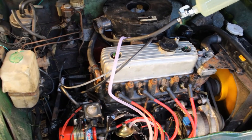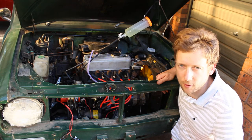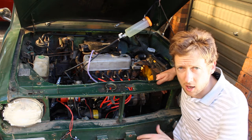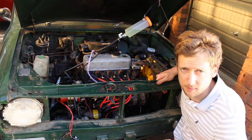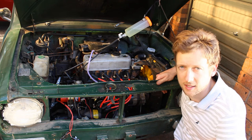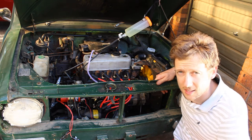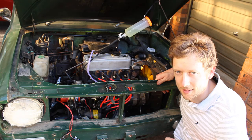You can hear there's a bit of a backfire, so some timing refinement is still needed. That's it for this episode — we've got the car running and we're happy with that. However we've got refinement work to do: getting the timing right, stopping the backfires — that's probably a matter of playing with the carburetor and advancing and retarding the timing to get it just right, making sure acceleration responds immediately without any issues. Next episode we'll be dealing with that as well as the braking and clutch reconditioning. This car hasn't been used in over 10 years — the clutch master cylinder had seized — so there are a lot of issues that need to be repaired before it gets back on the road. Like and subscribe to see what happens in the next episode.